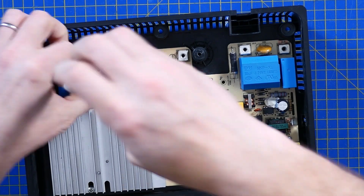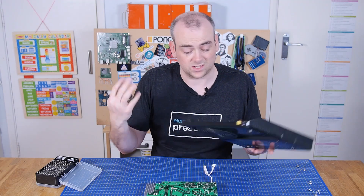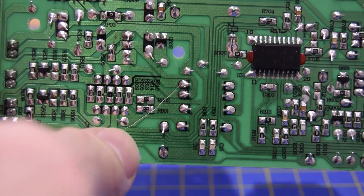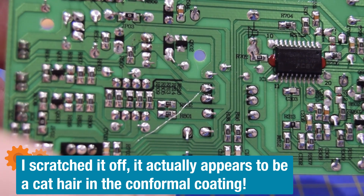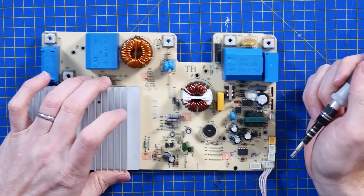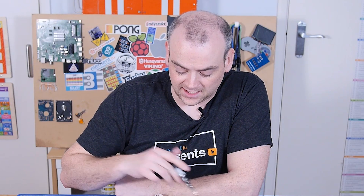Let's get this main board loose — this is the board I want to be careful of; nice big traces. Incoming power goes through capacitors, and this is a relay switching the high power through to the induction circuitry. Otherwise it just powers this little bridge rectifier — you can see four diodes and a couple of transformers — and that feeds the electronics side.